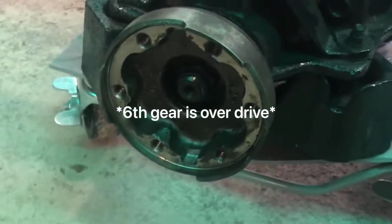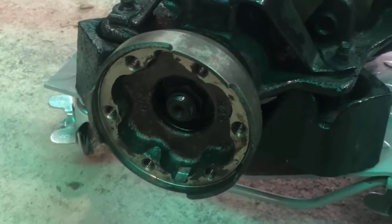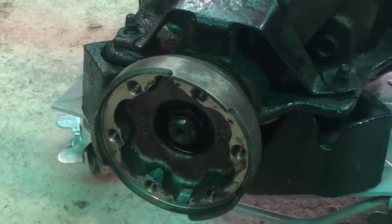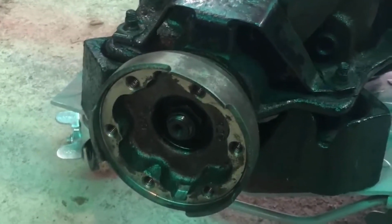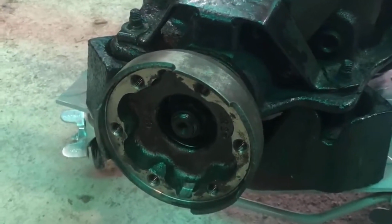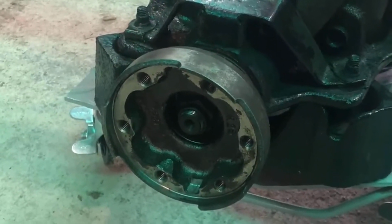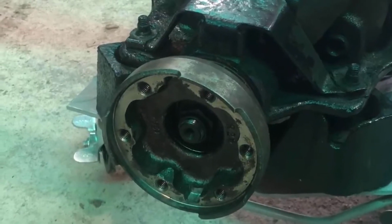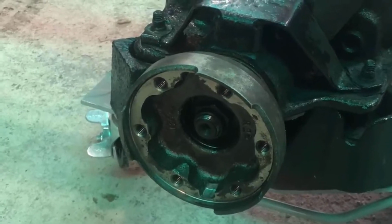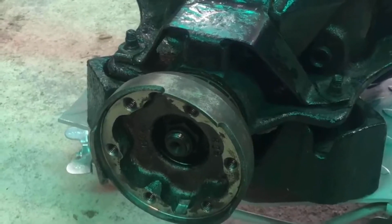Right here is pinion flange for 11 to 13 car. That is great because now all we have to do is shorten the drive shaft. We don't have to have anything welded. We'll take it to probably Marietta Joint and Clutch. They said they can hook me up pretty good there, so we'll have to take the car down there, have them measure, cut the drive shaft down to where it needs to be, and get it rebalanced, and then basically just plug and play. It'll bolt up to the trans. It'll bolt up to the rear end. And we won't have to do anything else as well. Otherwise we'd have to have a pinion flange welded onto the drive shaft or buy a custom drive shaft.